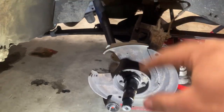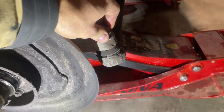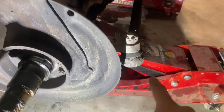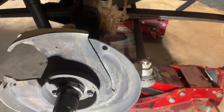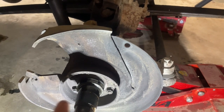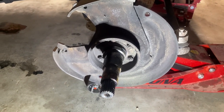On the passenger side I've got it pulled apart and this really escalated a lot further than I was wanting to go. If you notice when you wiggle this, the hub moves but the tie rod does not. So I just went to several auto parts stores to get new tie rod ends, new upper and lower ball joints, a new spindle seal, and a new drag link for the steering. That only took far too much time, but we'll get to tearing this apart.